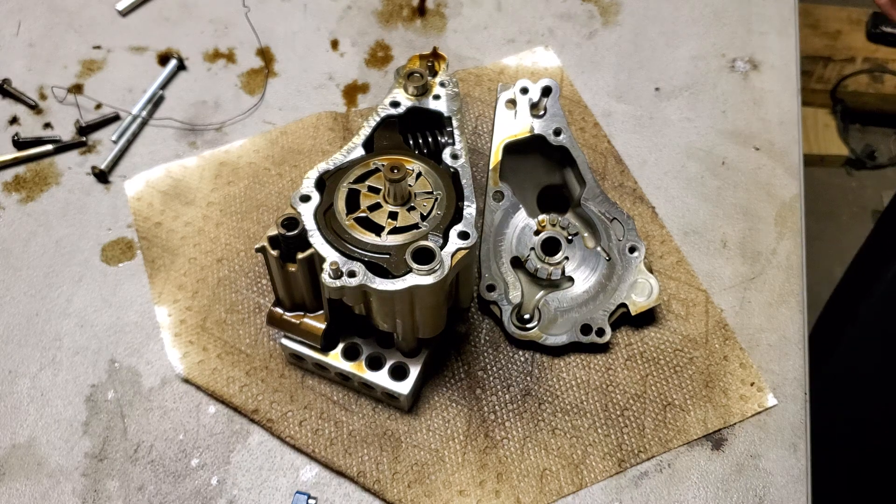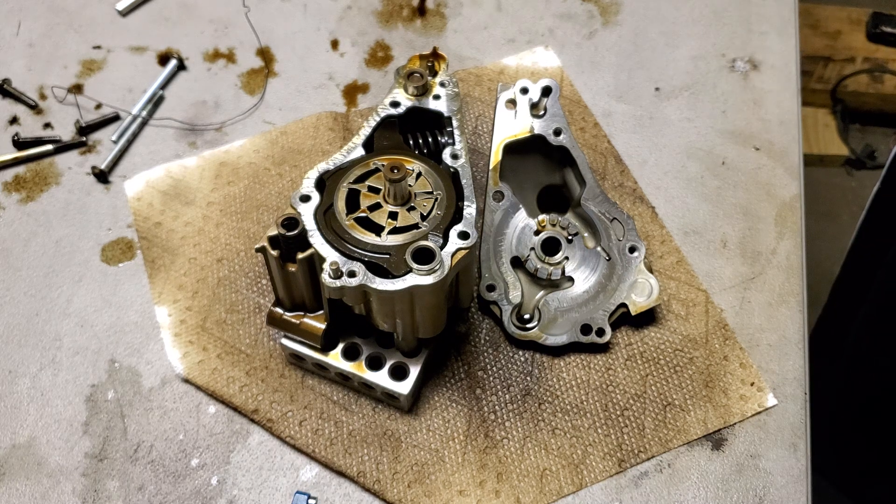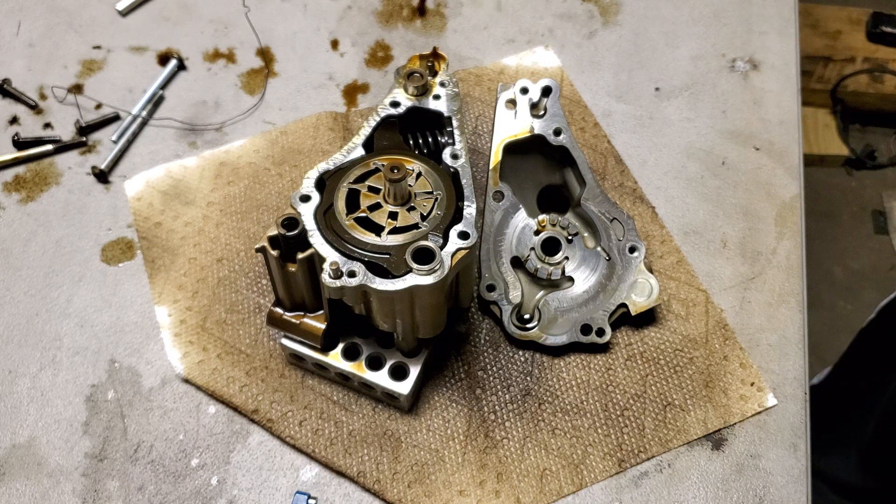The only real difference is that BMW decided to optimize oil flow to have the absolute minimum oil flow at any particular time, in order to use the least amount of fuel — because the oil pump does drain a significant amount of engine power. So in the process of this optimization, one needs to ask: what happens if this engine just happens to need a higher oil flow rate? Well, it would need a higher oil flow rate if any of the journals had a slightly larger tolerance and was leaking oil faster than it did from the factory. Now there are dozens of journals all over the engine.